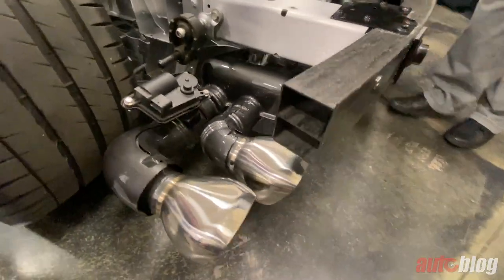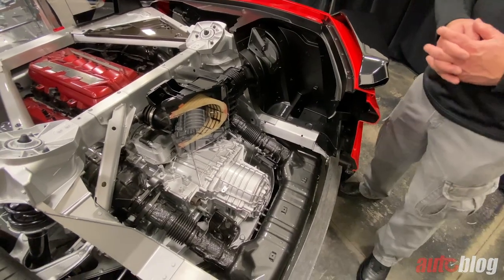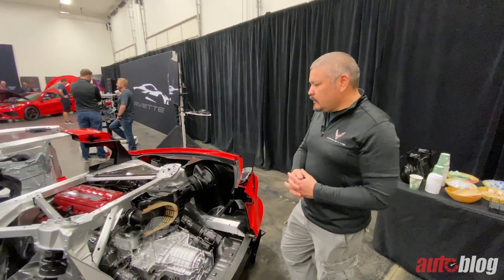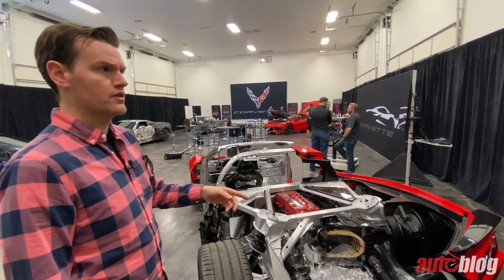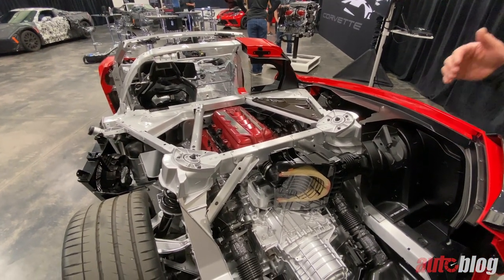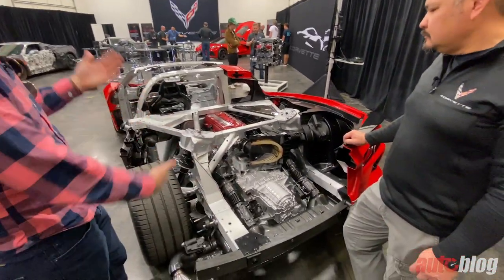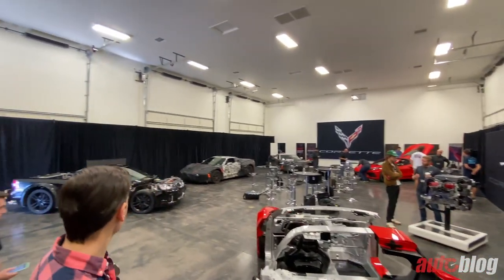Another big feature that not all mid-engine cars have is a decent-sized trunk. We tried to package it so there's enough room for two sets of golf clubs or anything similar. There was a lot of development meetings dedicated to preserving that packaging area and making sure everything you put in there doesn't overheat. The sources of thermal energy are concentrated to one spot now, so you have to make sure you can get proper airflow from the sides, bottom, back, and top of the car into the engine bay — especially since, unlike most mid-engine cars, there's a big trunk in the way of typical rear venting.